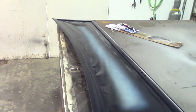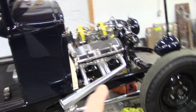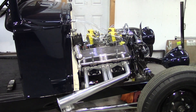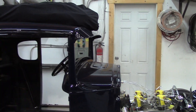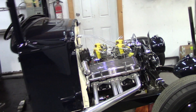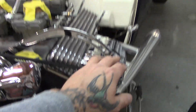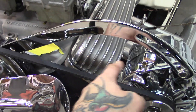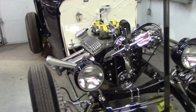We've got a windshield to install — got her up in the air. Hoping to get my new oil pan on there today; the pan I put on last time had a couple little pinholes and leaked a little oil. We're also going to get the rad in, the grill shell on, and the windshield. During the week I managed to swap out the belt — gives me about an eighth of an inch of adjustment, it's very tight, and I've still got lots of clearance between the alternator and the valve cover.